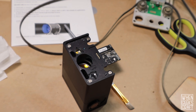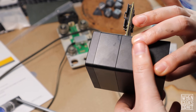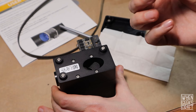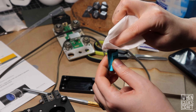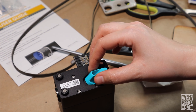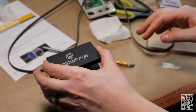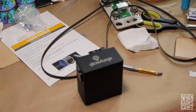It is now installed again and good to go. Now what we're also going to do while we're here is clean off the side lens, then flip it over and check that the mirror is good. The mirror is super dirty so we're going to clean this off really fast. Then you put this back in just like you found it, with the Glowforge piece pointed outward. This is all magnetized in place so we're just going to put this back and it sucks right back in. That's cleaning the entire head of the Glowforge.